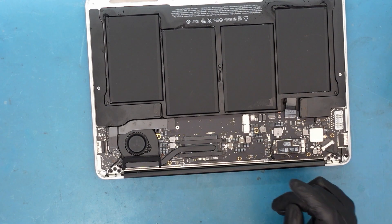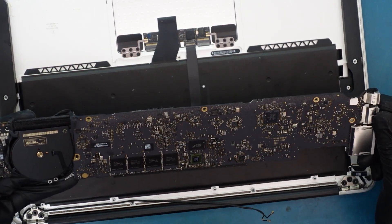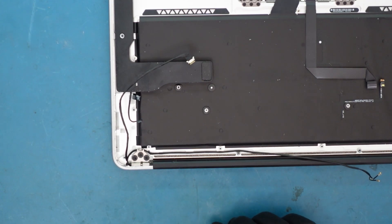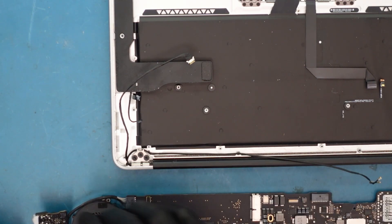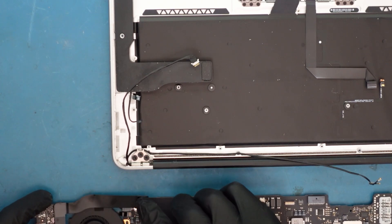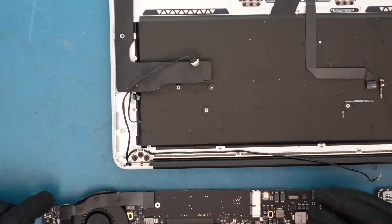There's no power, so something is definitely going on. We popped it up — nothing too obvious visible. Let's go ahead and test again with everything removed to see if we get the same symptoms, making sure we tackle easy things before the hard ones. Plugging it in — still nothing, no light at all. So we need to look under the microscope and see if there's a short.